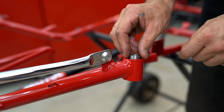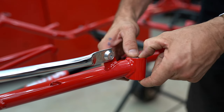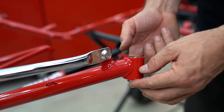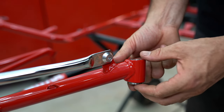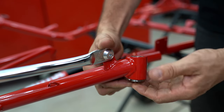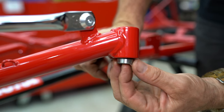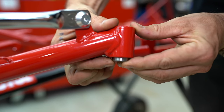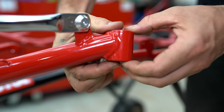So we're going to move on to the stub axles. We've got some brand new bearings — now this being a bit of an older cart they just push straight in. Normally they're a bit of a press fit but this one's a bit of an old girl so they're a bit flogged out. Probably could have thrown a bit of powder coat in there to tighten it up but we didn't do that. If it is a bit tight, just make sure the bearing's not going in on too much of an angle — get that bearing in nice and square.